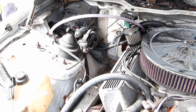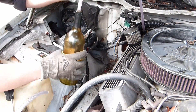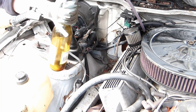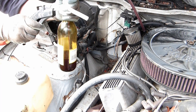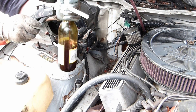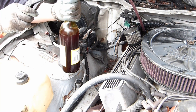I stop at the bottom — I could keep it going but just to be safe and not create a mess I stop there. I fill that up into one of the containers. The reason I did this was to save the fluid and reduce contamination, because on a GM 700r4 transmission there's no drain plug — you have to drop the pan, which can introduce dirt and dust from the bottom of the car. With this method I was able to get maybe a gallon of fluid out of the transmission and save a few bucks.